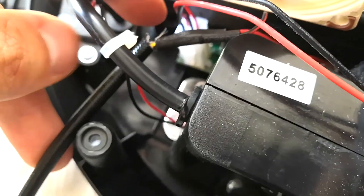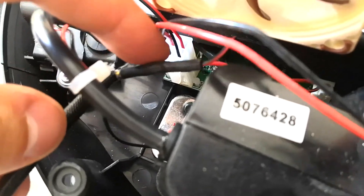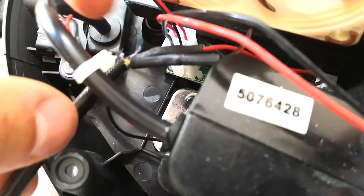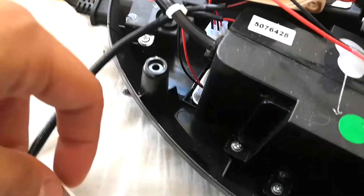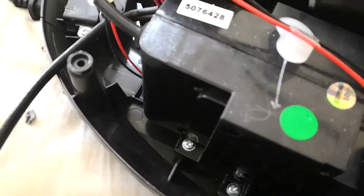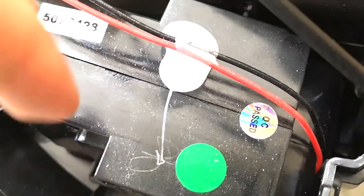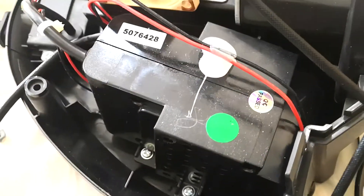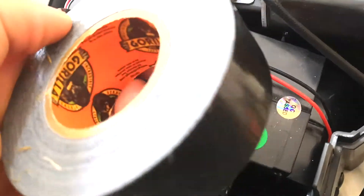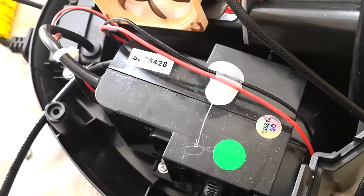If I could be bothered I would solder it — I've done loads of soldering in the past. If it ever fails, I'll take it all apart and just solder them together. But there's the extension cable, so I just need to cable tie that and then stick it down. I also notice that isn't stuck down, which it should be, but they use cheap glue gun stuff in the factory. A really good tape to stick stuff like that down is Gorilla tape — just buy some. It's really, really good and hard wearing, almost like a fabric material, and it's brilliant for stuff like this.